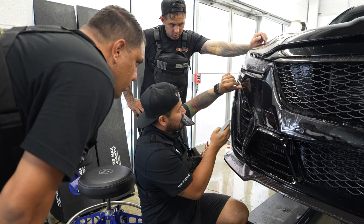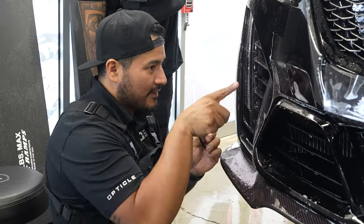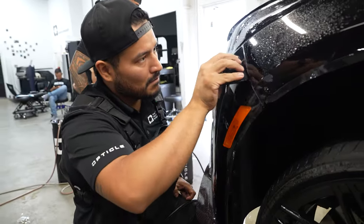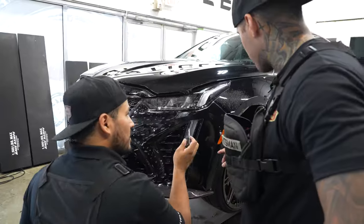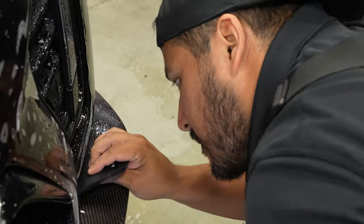Really, it's super nice. Just the way you're moving it that way. It's all working. Yeah, it pulled all the tension that way. So how you bunched it up and pushed it all to one spot, is that just to keep it from silvering? Yeah, I'm trying to find an exit. If I push into where it's already tacked, I'll get that silver right away.